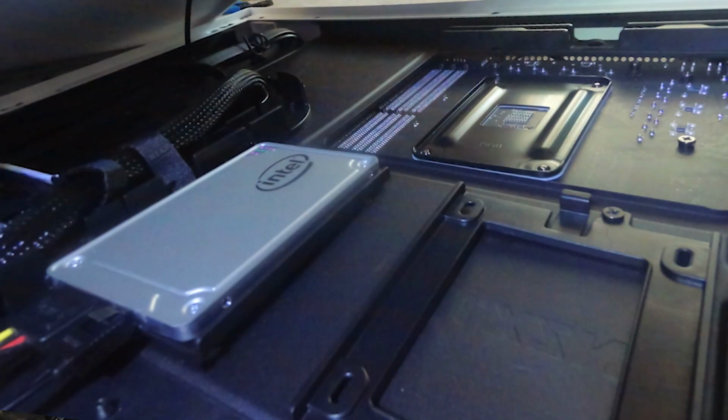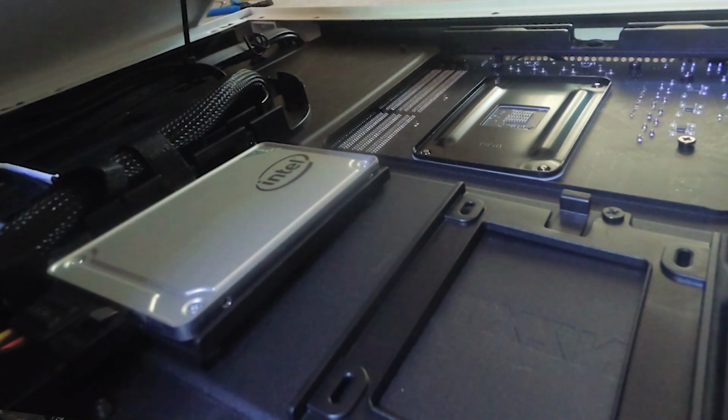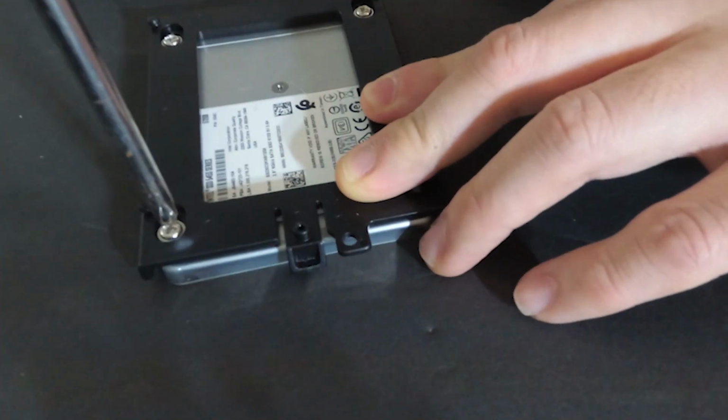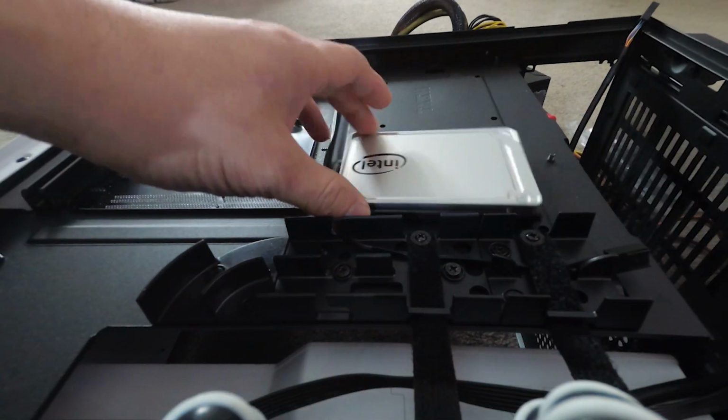Next, we installed the hard drive and the SSDs. This requires removing the back panel of the PC case. Make sure to unscrew the hard drive tray from the case first. It is much easier that way. Use pro tip number 3 reasonably. After the hard drive, unscrew the SSD tray and screw the SSD to it, then to the back of the case.